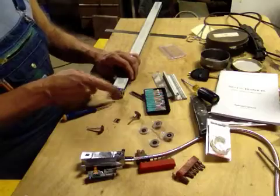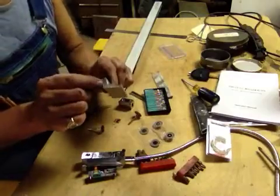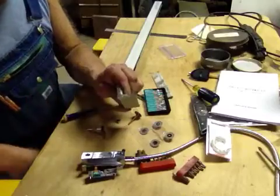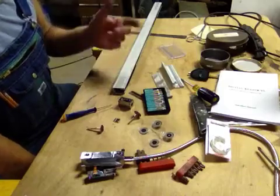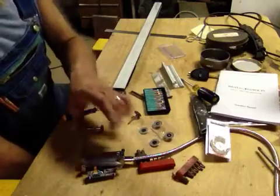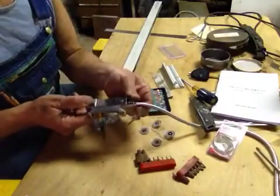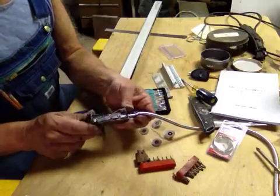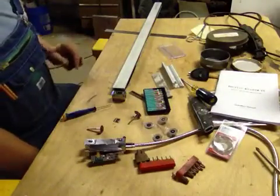The other problem was I had to re-drill the holes. As you can see, there were holes drilled and tapped, and these are metric holes. I didn't happen to have a metric tap, so I had 2-56 screws and tap and I just drilled it for 2-56 — they just hold the end cap on. Now the reader that slides in this assembly — I removed the reader, and here's the reader itself. There's quite a bit of electronics on it, as you can see — it reads the glass. I very carefully removed it and I'm going to be inserting it when I put this end cap on.